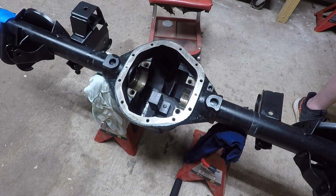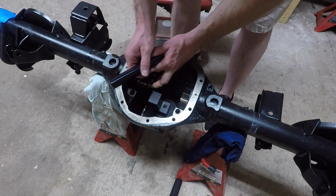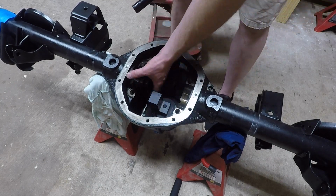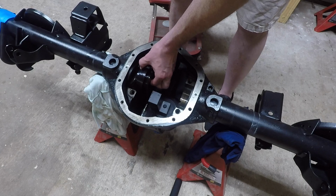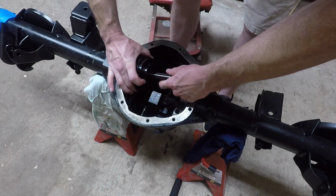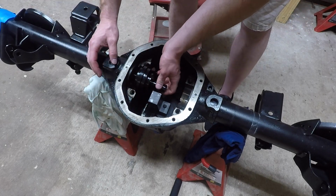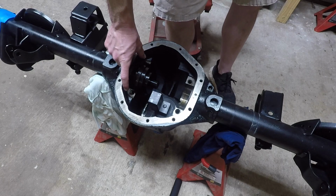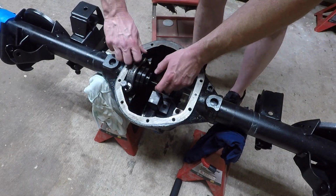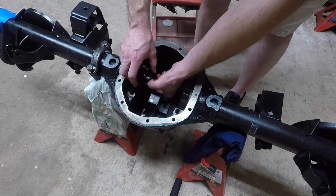The tool, as used, I ended up starting off, I believe, at about 52, 53 thousandths is what my pinion depth was supposed to be starting at, where my final depth ended up being like 64 thousandths. So next time when I do the Dana 30, I'll be sure to use a dial inch-pound torque wrench and torque that to 15 to 30 to see if it's possibly more accurate. I think it is more accurate. I think it's just my mess up.